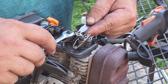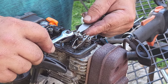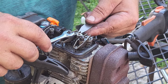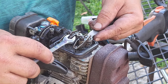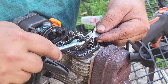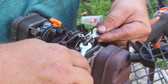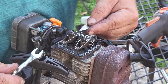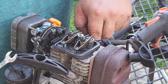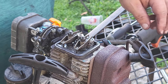It's not going to take a whole lot of movement. I use my finger to brace against the motor and wiggle the gauge in and out while tightening, finding the point where it fits but drags slightly. I'll do the same thing on the other side. This thing was way out — I'd say it was out by three or four thousandths at least. Now I've got just a slight bit of drag on each one, and wobbling back and forth I'm getting nothing, confirming I was on top dead center.